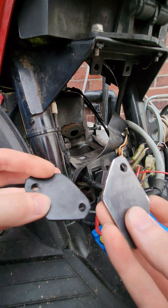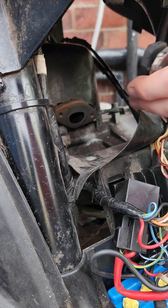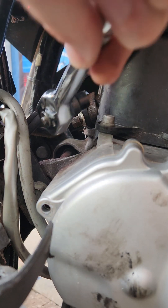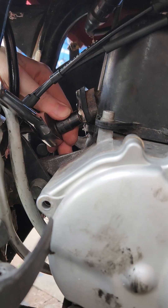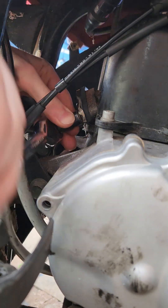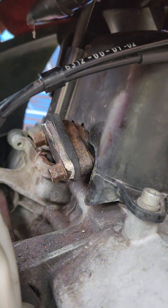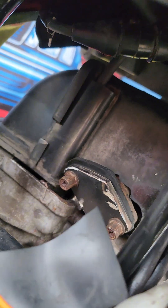What I've done here is made this metal bracket and this little rubber piece, and I'm just going to block off the exhaust port with these two pieces to stop any air from escaping. It's super important to have one of these air leak-down test kits because if there is an air leak anywhere on the engine, you can spend a lot of time and money changing parts trying to find out what the problem is with your bike, and it could just be a simple air leak.